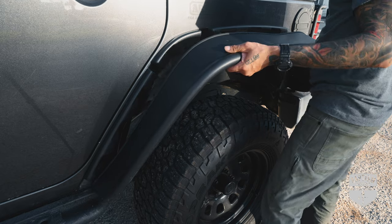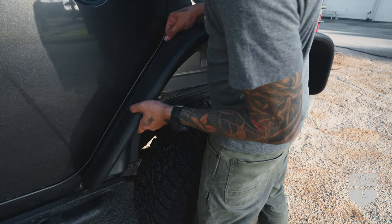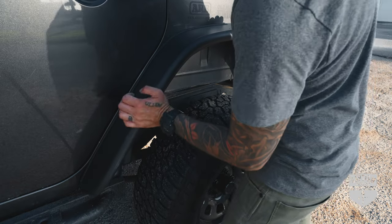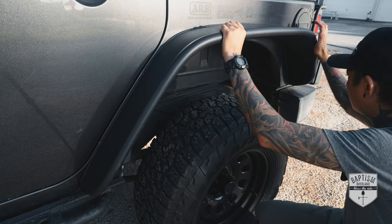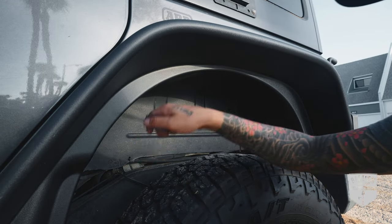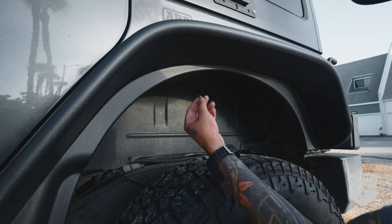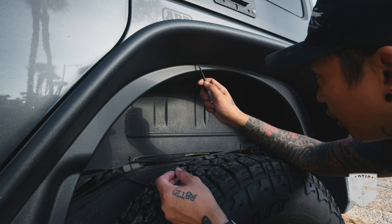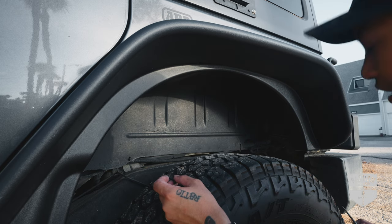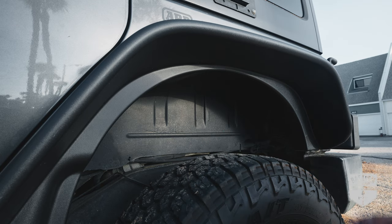The next step is to mount the fenders to the brackets. Because it's plastic there will be some warping, but it will fit over the brackets. You'll need to do a lot of maneuvering and pulling. Make sure to check all around that the fender is properly seated on those brackets without any gaps. Pro tip: I found that using a heat gun to just heat the fenders up slightly made it easier to maneuver. Before you put this on, make sure all those clips we put earlier are still lined up to those holes and didn't move, because you're now going to screw into them using the provided screws. You can use an awl to find where that hole is, but it gets tough because sometimes it's off by a lot — you just have to find it and move things around until you get to it.